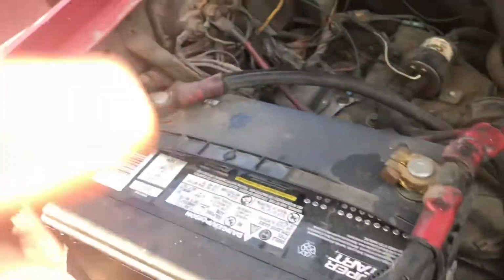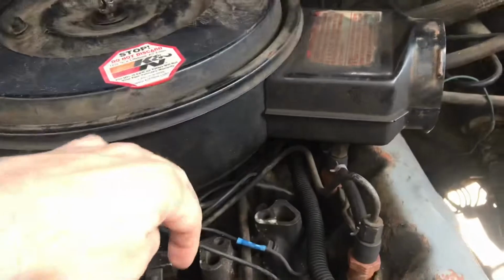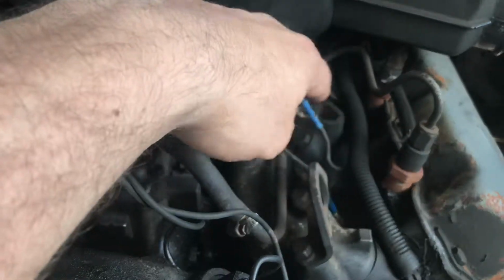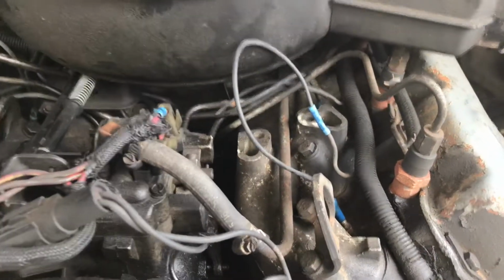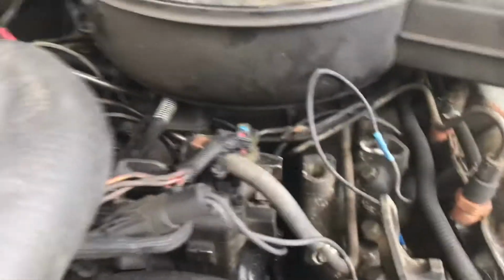Okay, so another wire. This is the wiring to the push button. You can see where he wired that in. Now, for those of you who don't know this truck, or you do know these engines, this right here, he made his own, I guess you call it, glow plug harness. He did all this himself, and it's all the way through. He kind of spliced in and did his own thing, which I'm sure is probably where he's getting the problems, since those rely on resistance. That's probably where I'm going to start when I start tearing this apart.